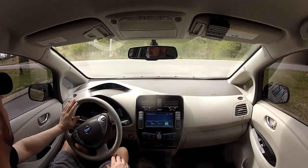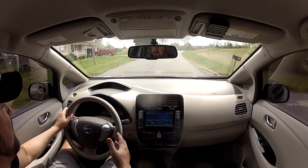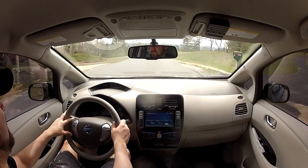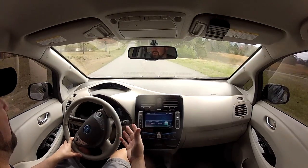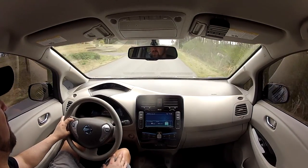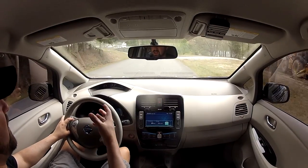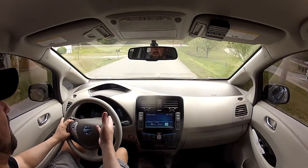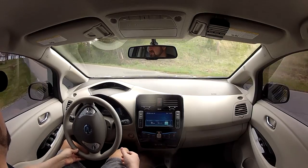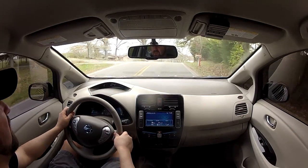It's extremely quiet and extremely smooth. I've got eco mode on right now. From what I've been able to tell, the eco mode button basically halves the amount of acceleration the accelerator pedal gives — unless you absolutely floor it, then it'll give full power. But pretty much the other 80 percent of the range is just half compared to what you'd normally get with eco mode off. Eco mode does help with range. Right now it's already jumped up to 85 miles of range just because I'm in eco mode with the air off. If I take it off eco mode and turn on the air, it drops back down to 78 miles — so it automatically adjusts as you're driving.